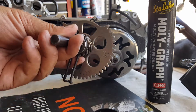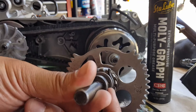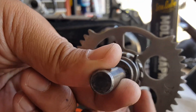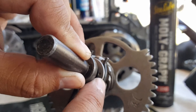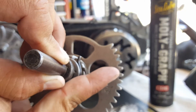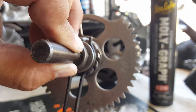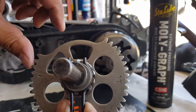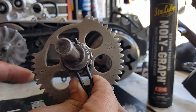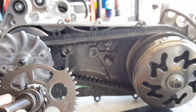Make sure this is facing the right way — this arrow needs to point horizontally toward the variator shaft. There's also a little indent dot right there. It's going to be painted pointing a little bit above horizontal, not a perfect 90 degrees but just slightly above the horizontal markings, for our kickstart gear set here.